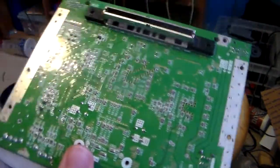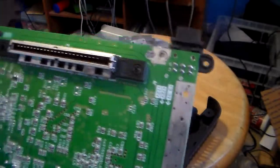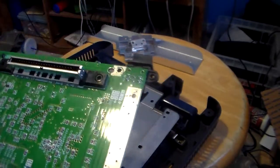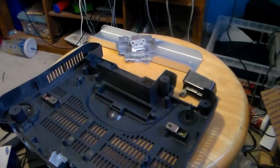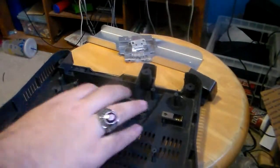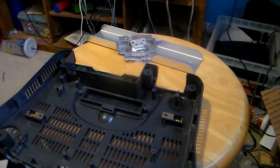This is what the back of the board looks like. If you have the Pokémon system, the wires will be soldered right here. Here's the expansion slot for the N64 DD — if you were going to build a portable out of this thing, you would need to break the contacts off of this, unfortunately. The DD was never released in the US, though there were a few accessories that used it. Here's also the metal shielding on the bottom and the back panel for the N64 DD.